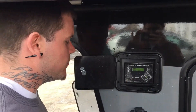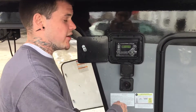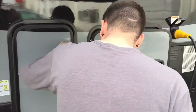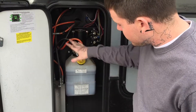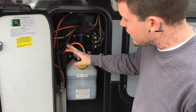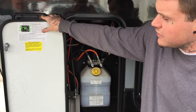It's solar prepped, so if you buy a secondhand solar panel you plug it in here and it'll automatically tend your batteries, keeping them charged while you're dry camping. In here you have your hydraulic pump, reservoir, and solenoid for the hydraulic system. It's got all your lines that go to each one of your landing gear, and it just distributes fluid where it needs to go to level everything out.